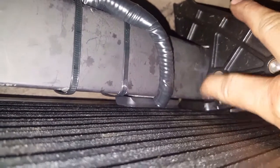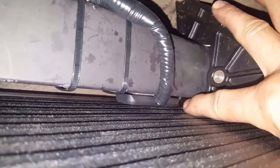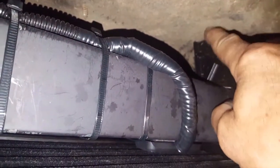The motor here. So I drilled the rec tube and mounted rivnuts so I can bolt it down here. I used this area here flat against the bracket and down here, and we trimmed off like 2 inches up here, I believe, because it's hitting the bottom side of the cab here, so that was a fitment issue. And then I welded in, I believe it's channel iron, to catch that top angle mounting up there.